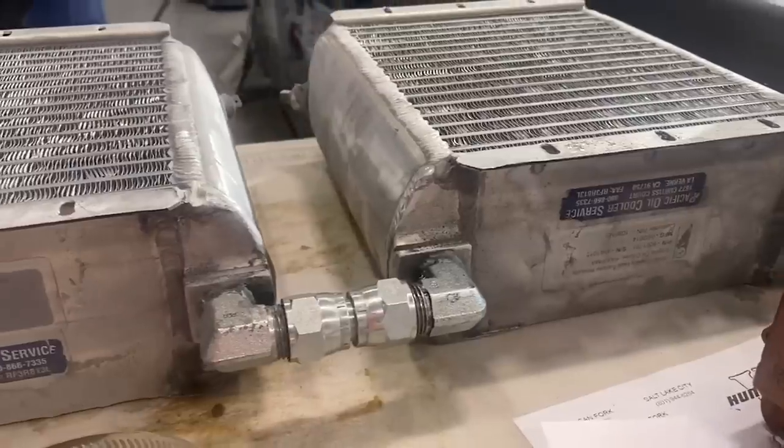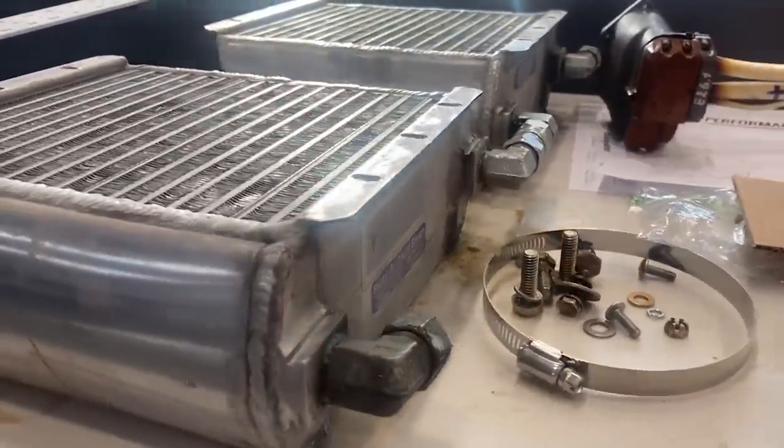I'm going to balance that out, but to do it I've got to fill the oil cooler. The problem is I'm not using a geared high-pressure pump — I'm just going to gravity-feed it, so it's going to take forever. Fortunately I've oversized all the lines and ran it without a bunch of 90-degree fittings, so it's a simple clear path. I did a flow check and oddly enough, the single cooler with my oversized lines has less flow restriction than the original engine had in my race plane where I had two coolers, smaller lines, and all the 90s paired together.